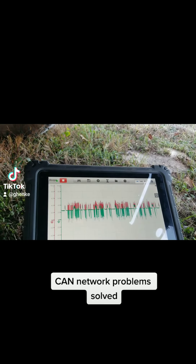Well, it turns out it actually still won't start. There's a CAN terminating resistor that has to go through that module before it actually will start. Here's how I know: I'm measuring high and low CAN — I'm at 123 ohms and the network's dead. There's a terminating resistor that's bad in this truck, or a module that's bad that has one.